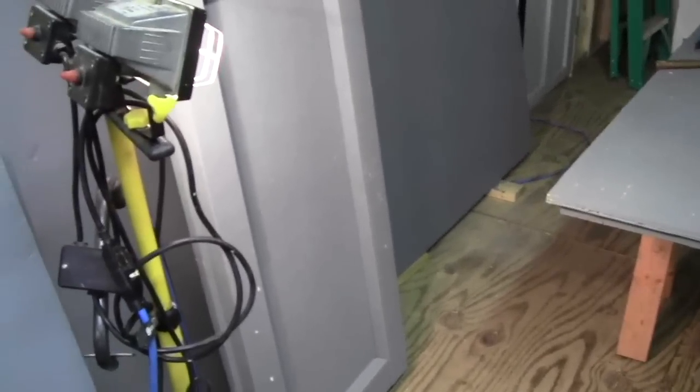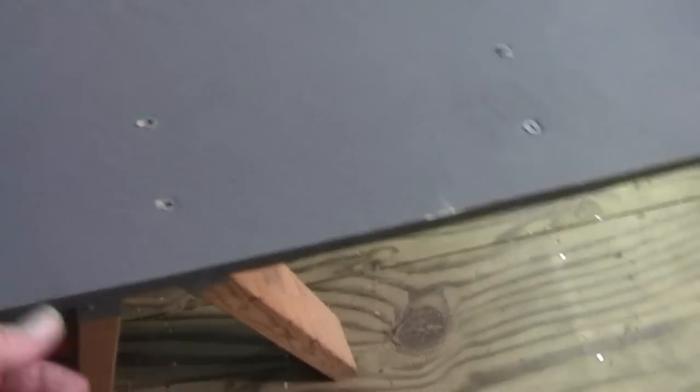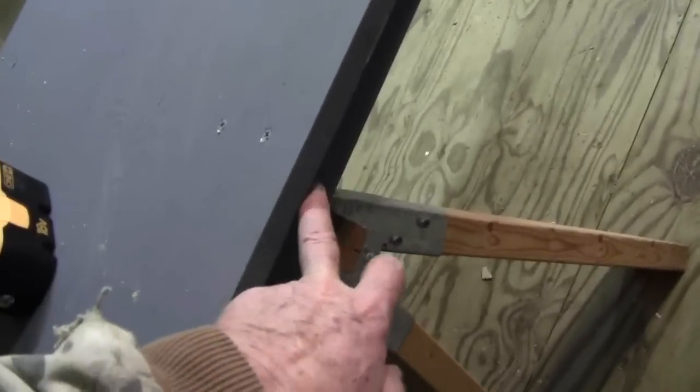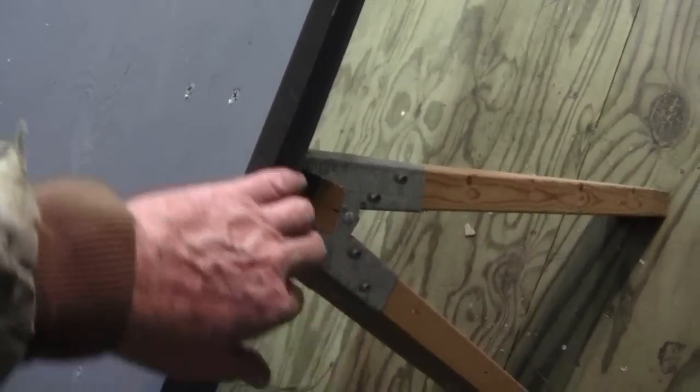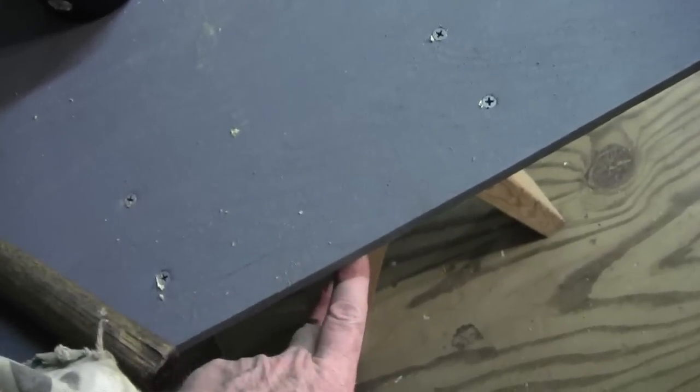I did get a little bit of work done on my box this weekend. That's the right-hand side and that's the left-hand side — you can see it's cut out for the tailgate to fold up under there. The top is flat so I can cap it, and this lip right here will go over this edge. That two-by-four right there — you'll screw the floor into that two-by-four, and it will be tucked under there so when the trailer is up, this seam comes down and the plywood is underneath.